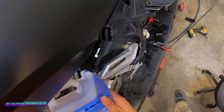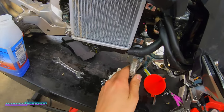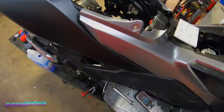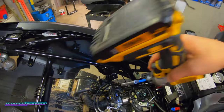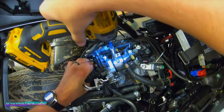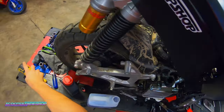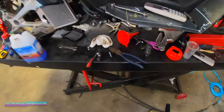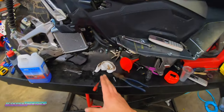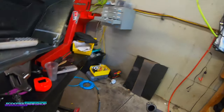Put our coolant in here. Just taking a peek to see if anything else is loose. We've got the valve cover on, we have the throttle body back on, got the clip for the fuel injector, a few miscellaneous mounting brackets. I still need to bolt a few things on — I'm not going to put all the panels back together since it doesn't really make sense at this point. Need to put the exhaust on, start it, make sure it runs good, and make sure it's got proper lubrication and the cooling system is all together. You want to make sure that little lip there bottoms out or you're going to have an air leak and it's not going to run so hot.